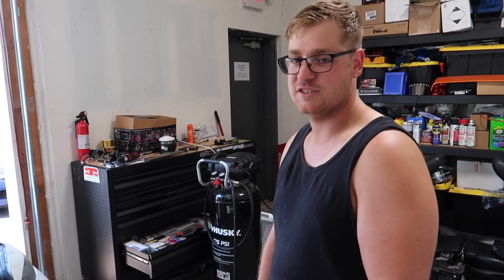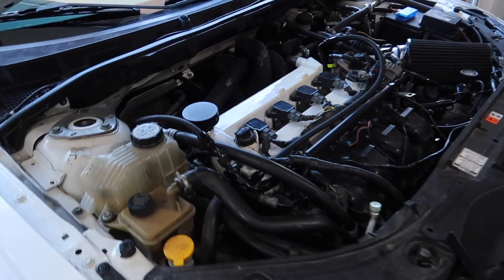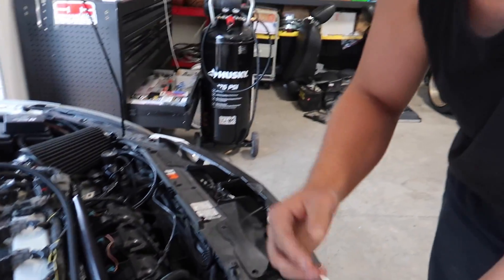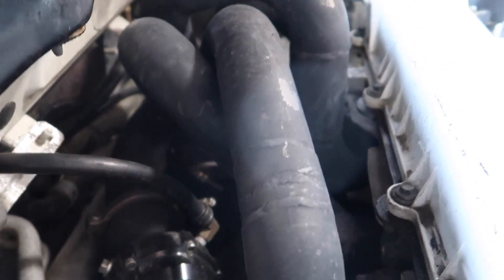If you want to go over it a little bit, what's done to it — just like turbo, stuff like that. There's a ton done to it. We can start back here with the turbo and the crazy looking manifold. The manifold is actually a custom built manifold and it's got a Precision 46mm wastegate, external wastegate. And the turbo is a Precision 5858 dual ball bearing.